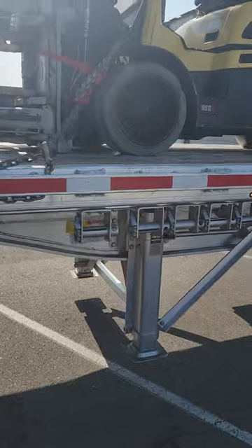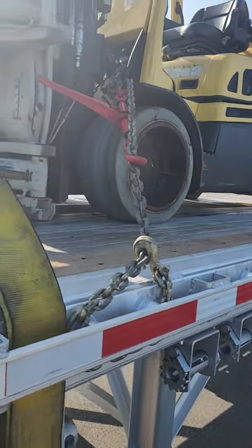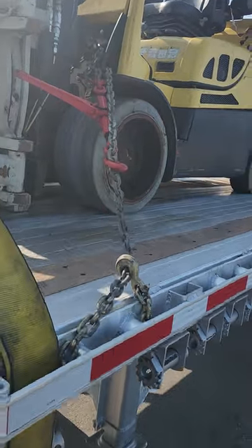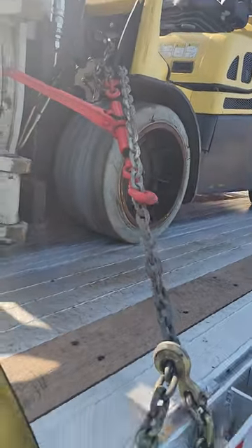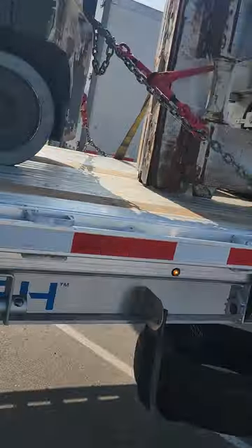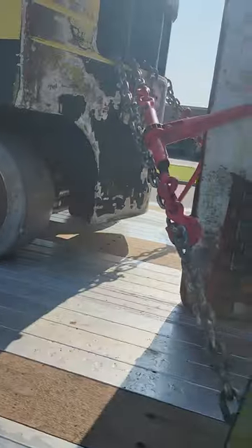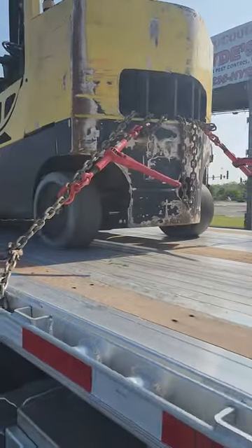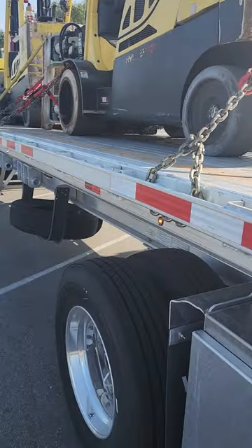Let me show you my load as an added bonus. See — chain one, chain two binders. That's considered two chains even though it's one chain with two binders. See I have the binder and the chain up there, with the slack going across. Did the same thing on the other side. One chain, two binders — one chain, two binders. And this probably illustrates it really nicely right here. Something across the lifts in the front — those are probably a whole pallet or something of that nature.